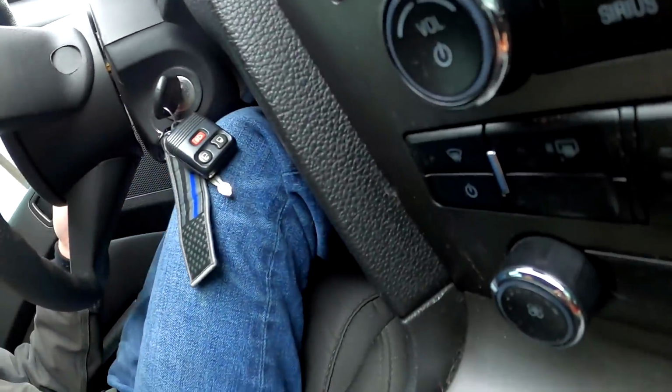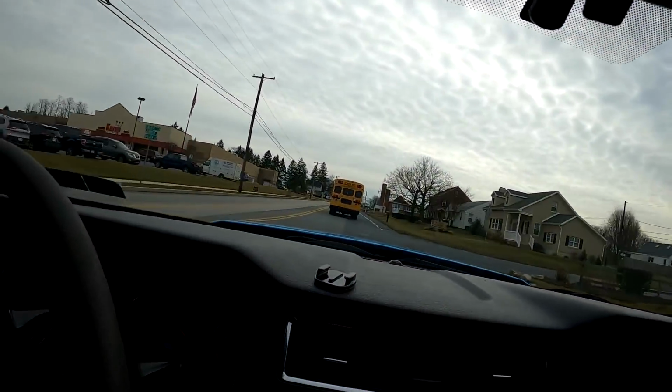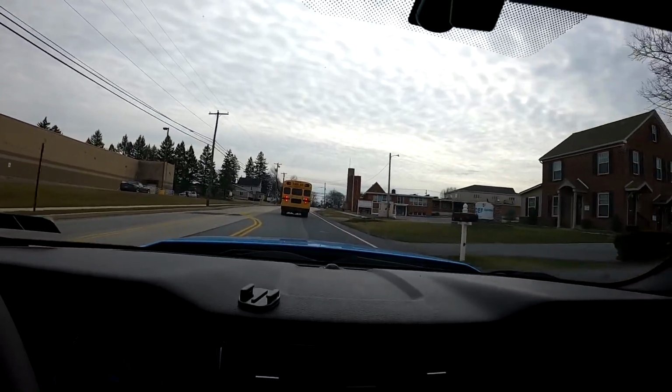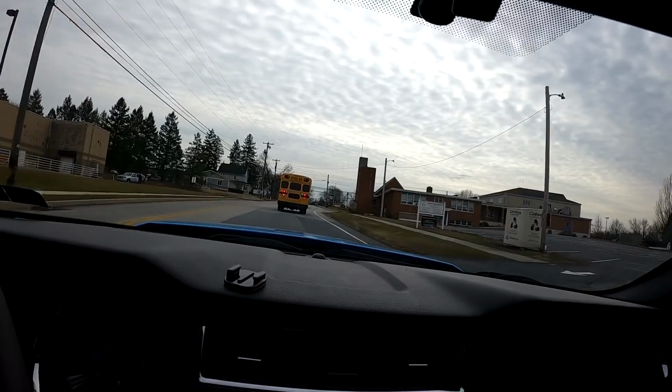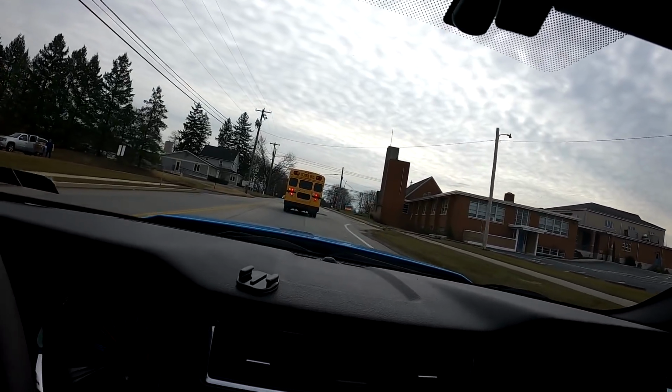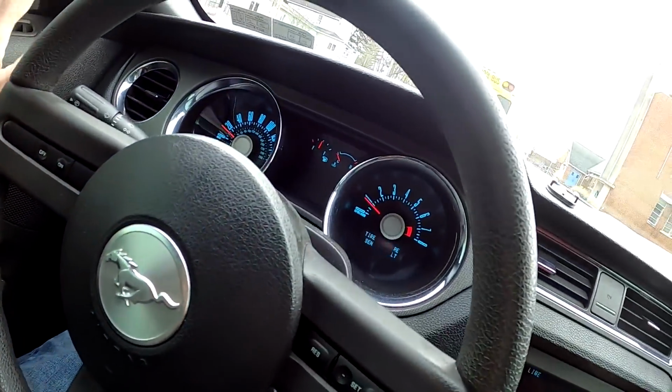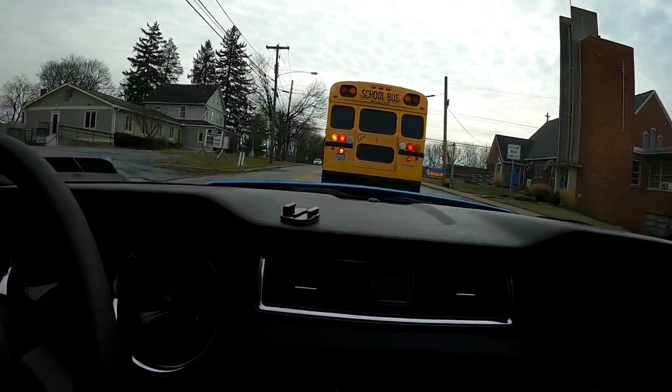I know I always complained ever since I got this car about how the clutch just doesn't feel right. There's problems, blah, blah, blah. What I experienced happened twice now, once in second gear and once in fourth gear. My clutch will be fully disengaged. Like I have my foot to the floor, the clutch pedal the entire way to the floor. And whenever I go to put it in second gear, it grinds gears horribly.